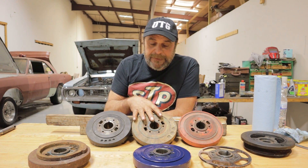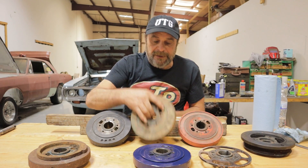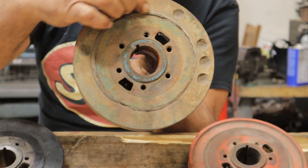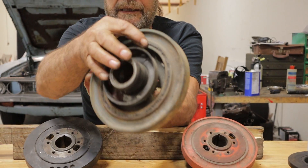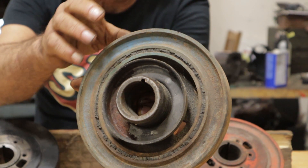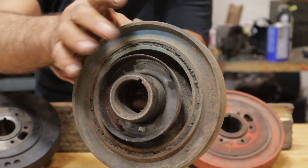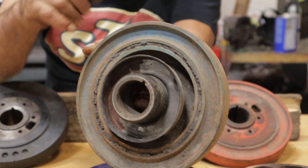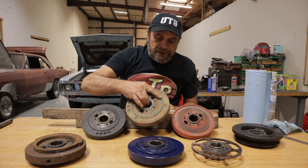The main liability with these is the rubber elastomer that separates the hub from the inertia ring. Here's an example of a bad damper — you can see the rubber is coming out of it, it's broken down and starting to squeeze out the sides. What likely happened is the damper soaked up a bunch of oil or gasoline, causing the rubber to swell up and then contract, squeezing it out the sides. This thing is no longer a usable piece — the inertia ring will eventually come loose from the hub.